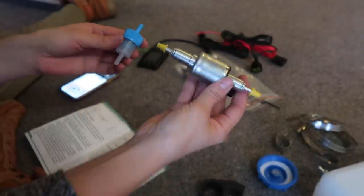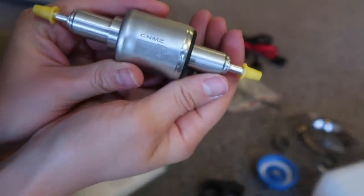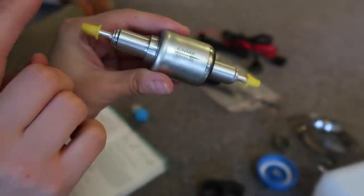It's a really perfect little work area. I started fitting together the filter and the pump. Your diesel heater will come with a fuel line. Depending on which one you get, it might come with a hard black rubbery fuel line, or it might come with one like mine — a squishy green fuel line. Some people advise you to replace the squishy green line. Connecting the filter and the pump is very straightforward. You just want to make sure the filter is in front of the pump, and that the pump's arrow is facing the correct direction — that arrow is the way the fuel will go.